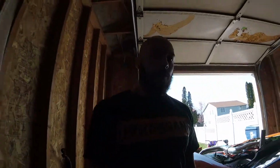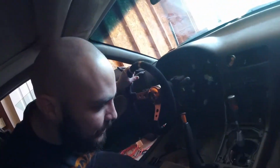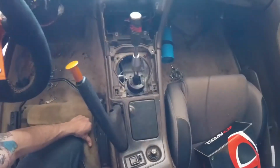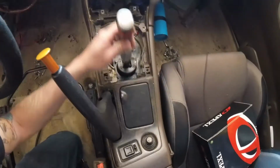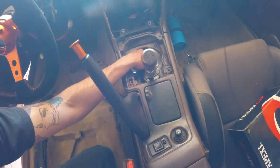A lot of splicing wires and using my lower 240 harness and other stuff like that. Hopefully you guys have good light in here, but I notched out right here for my transmission because it sits back a little further than the RB because I guess it's a shorter tail shaft. But it's gonna work, and I don't have that bolted in yet because I still have to put the transmission fluid in there.